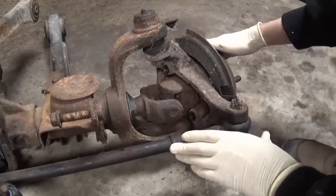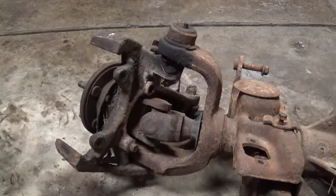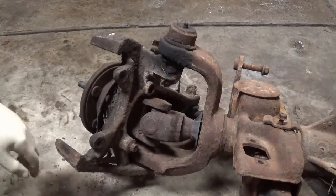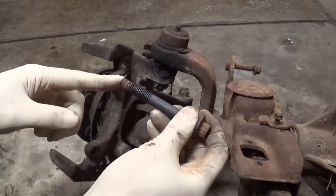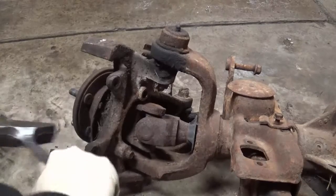I wonder about the last one — I have to turn this to the other side. Since the other two didn't give me much trouble, I'll go through what I usually do when it starts giving me trouble. On the impact, I'll go loosen, then tighten, loosen — just to see if it will move. The issue is that when loosening, the head was moving back and forth but the other end wasn't moving, meaning the bolt was actually twisting — and that's how you break them. Sometimes what I do is hit it and knock all the rusty crud off, because that crud prevents heat from getting where you want it.